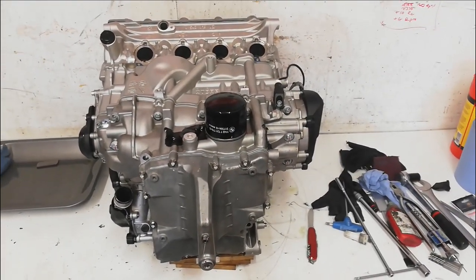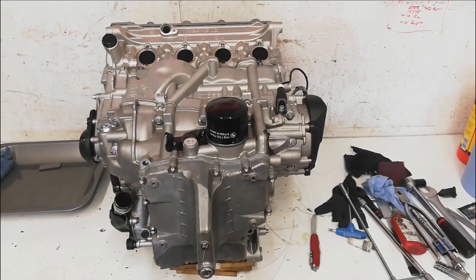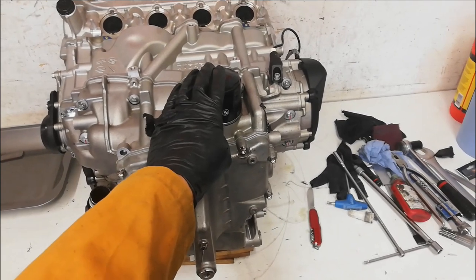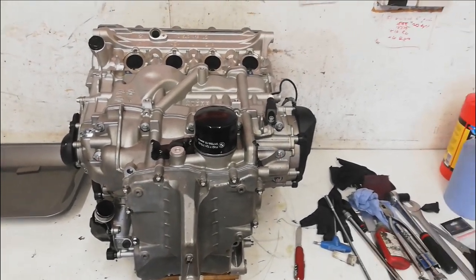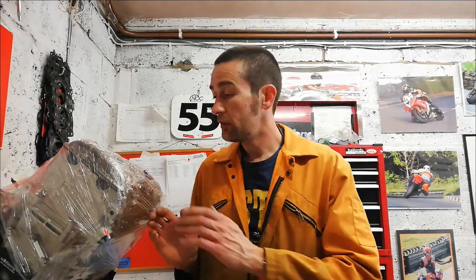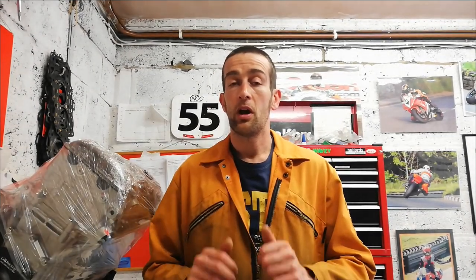That engine is now complete — I'm just going to wrap the top half in cling film to keep all the ports clear of any bits floating around. The oil filter I don't put on tight, because before you fill the rest of the engine with oil I always prime the oil filters so it's got a fighting chance of getting oil pressure quicker. This engine is ready to go back in. Thank you for watching this S1000RR engine refresh — I hope you found it interesting. These BMW engines are quite straightforward because the design is very logical. This in total has taken 11 hours to turn around properly, including all the measurements, checks and cleaning. It's ready to go back to its owner and hopefully do many, many miles.